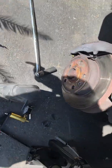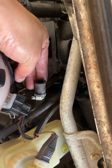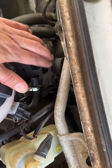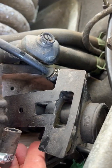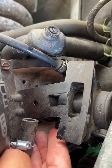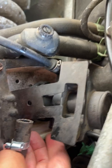I also checked it on this side here — this is the hose that goes to the evaporative container. There are a couple of ways to test this: you can test the valve while you run the engine and put your finger over this end of the valve. If you rev the engine you should feel it start sucking. I had to rev it up quite a bit, but eventually it did turn on and I could feel the suction, which shows that this valve works.